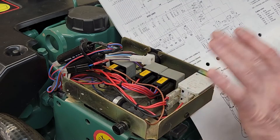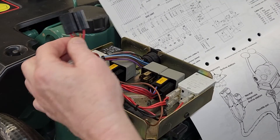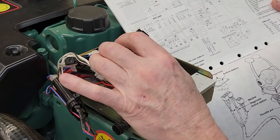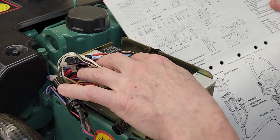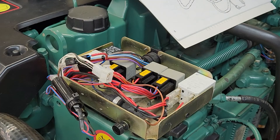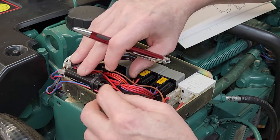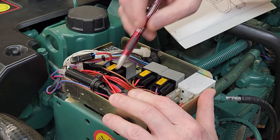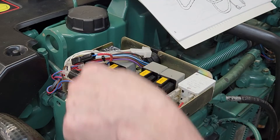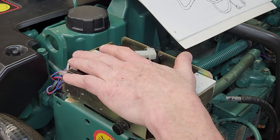I would suggest you look at the main relay — maybe even change it. Pull the terminal off, look at the connector, see how bad it is. There's some room in here and you could put in a new contact and splice in a new one if it's not too bad. Now if you cut back the harness and you start seeing green, the wire is green — it's time for a whole new engine harness. You're going to open up a can of worms and you're not going to be able to fix it. I've cut back in a harness two and three feet and the wire is still green. Once the wire turns green it has resistance on the outside and it's not going to work right. These are the main circuits to look at; you should have battery voltage at the diode connections here with the key on.